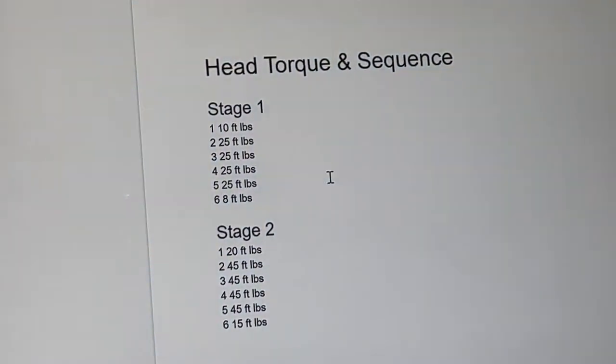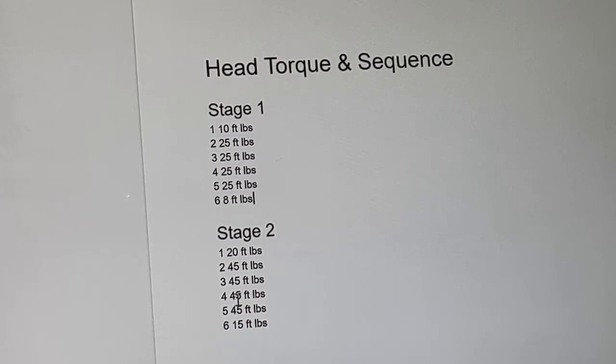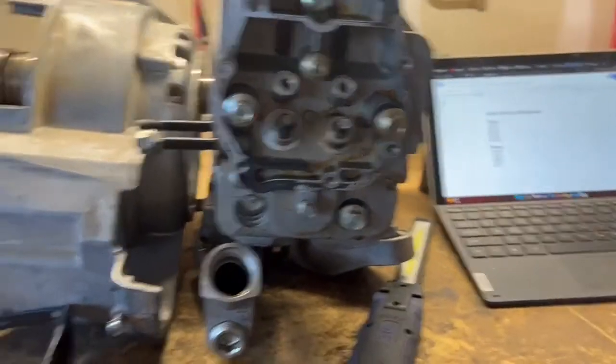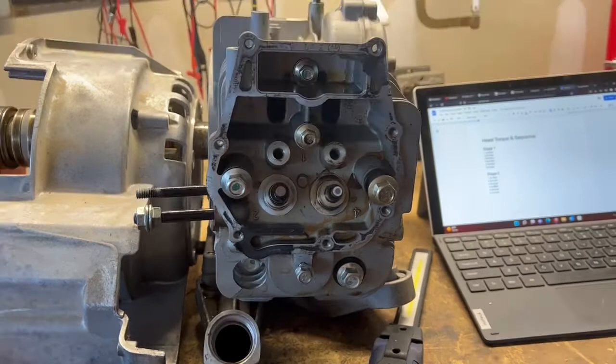Let's go over why I came up with these final numbers. In detorquing, we had a discrepancy between three and five — three came back at about 35 foot-pounds, and five came back at 65 foot-pounds. But four and two were our most consistent results coming back at 45 foot-pounds. That's why I corrected three and five and split the difference, because two and four were our most accurate. These bolts are the same size — they're both grade 10.9, nine-millimeter bolts. I looked up a torque chart that looks about appropriate for them. So that's what I would go with: 45 foot-pounds on your final stage.